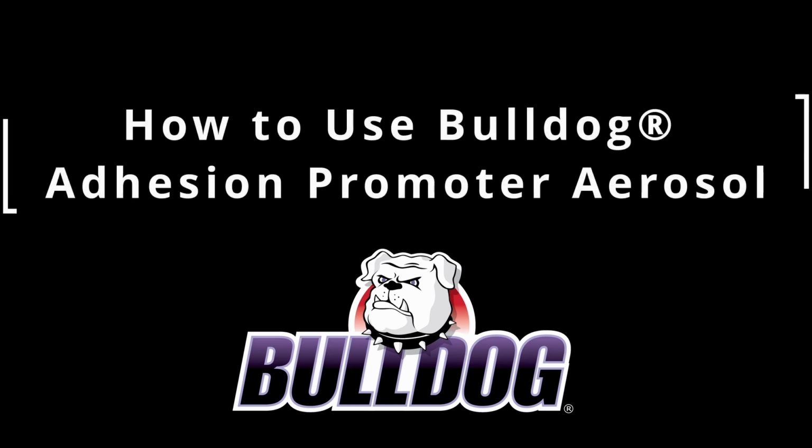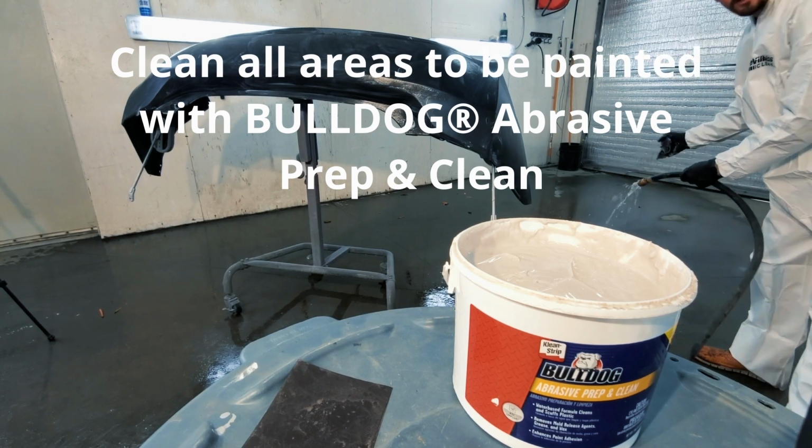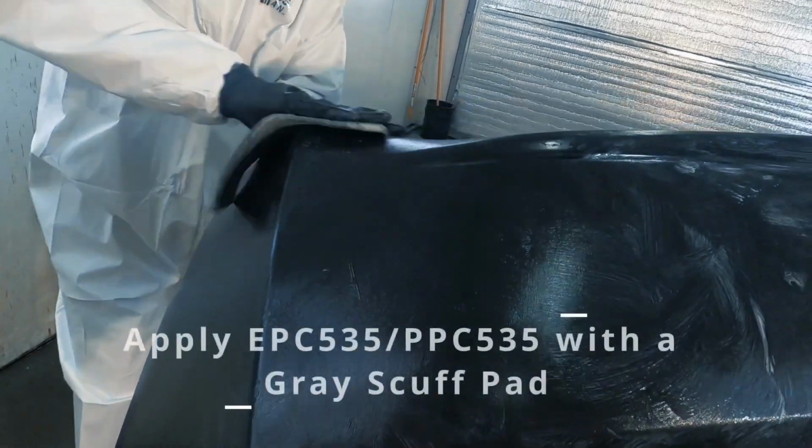How to use Bulldog Adhesion Promoter Aerosol. Clean all areas to be painted with Bulldog Abrasive Prep and Clean using a gray scuff pad.